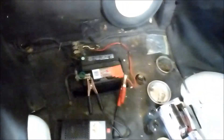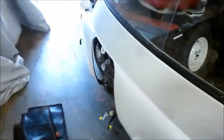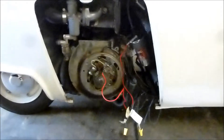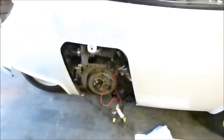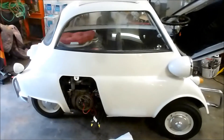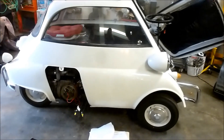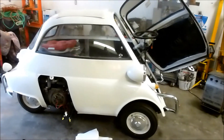It draws the engine down and starts whirring, but it doesn't charge, and that worries me. So I wonder if I've got a bad Dynastart, a bad regulator, or a wiring issue. If anybody has any ideas, maybe they can help me out and post a comment below. I'm trying to get this thing ready for the show coming up in three weeks so we can drive it and have fun. The battery's got to charge, so I'm going to keep playing with it — thanks for your help.